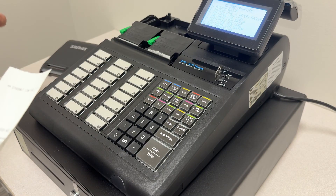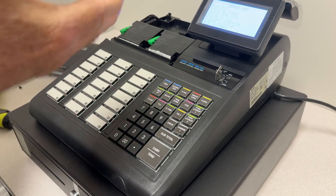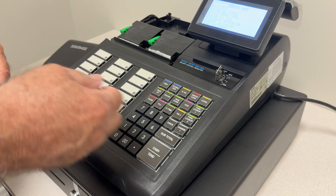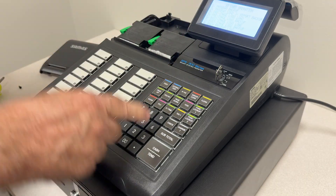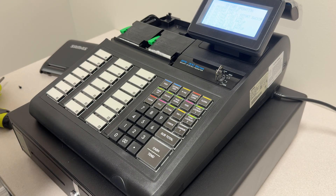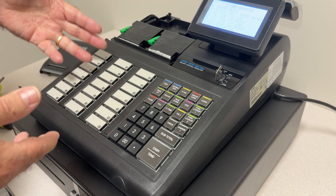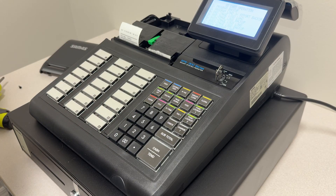Once we have it backed up, we can also reload it. If you go and make any price changes or change anything, those changes are saved to the memory card. If you lose power, get a spike, or something messes up the program and you need to reload it, go to service mode, press page down, press nine, then press program load. One important thing: if you messed up your program, you need to go back in and put the store name in first — it's on page 18. Put in whatever your eight-digit store name is, then simply press two and it will load the program.